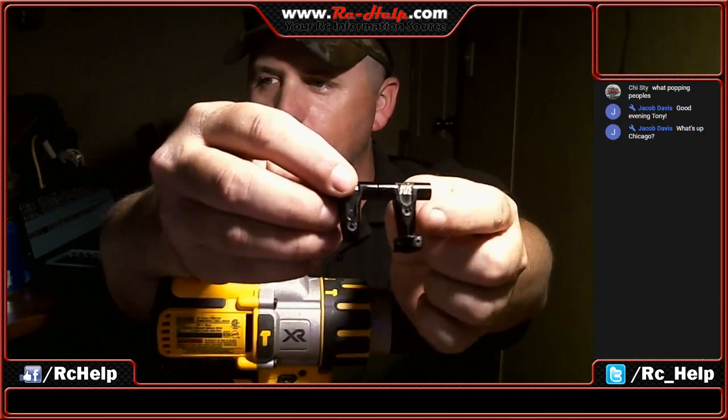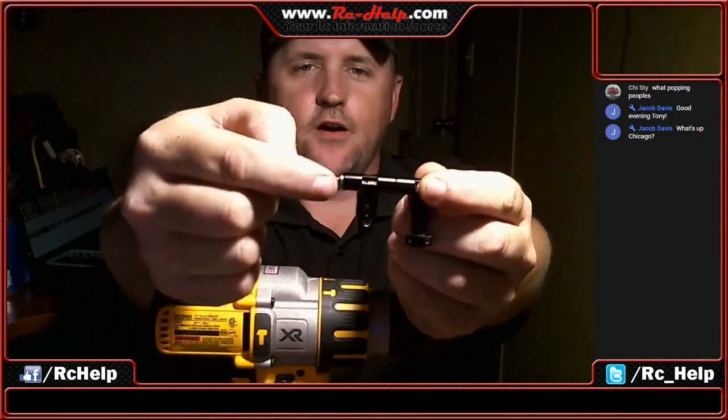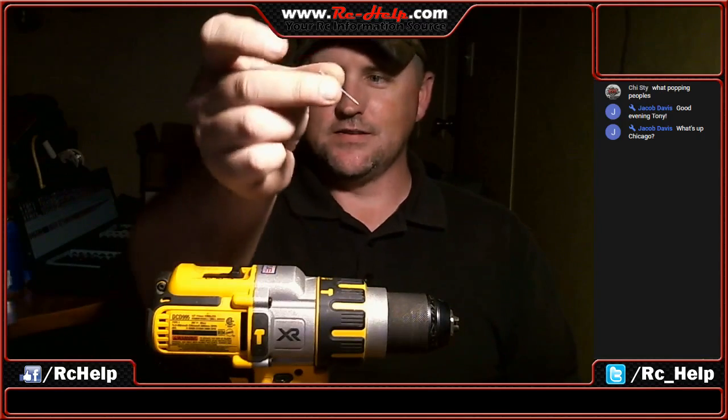All right. I want you guys to take a look at that hole right there, and then take a look at that hole right there. I've got a feathering shaft in here that's holding these things basically perfect. There is an 8 millimeter difference in where these holes are. 8 millimeters is, well, not exactly, but I needed 39 millimeter links. I had 32 millimeter links. That right there is why the links that came with it, these little bitty guys, wouldn't work.